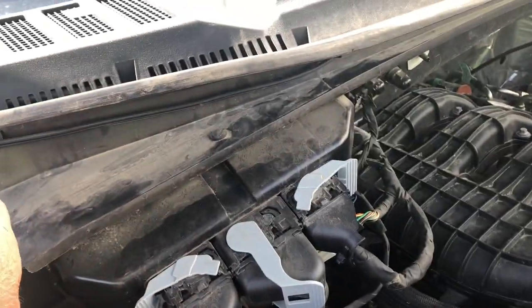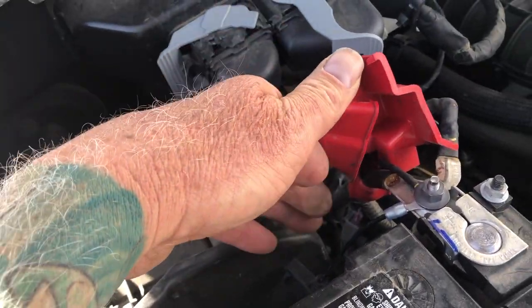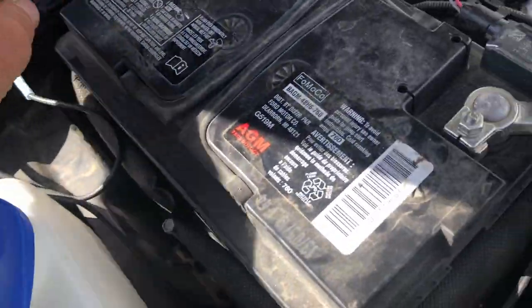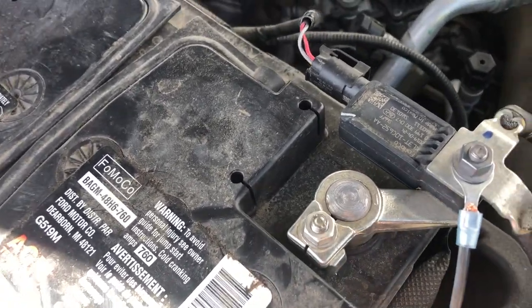Okay guys, that was actually pretty simple. I got that power line ran over here - the ribbed one is the positive and has an inline fuse. I crimped on a cable and over here all I had to do was crimp on a ring terminal and put it onto the ground lug. Okay guys, this has gotten kind of long-winded - I'm two videos ahead from here and it's still not done. But we'll end this one here. If you're interested in this towed vehicle brake stuff, you can watch the next couple of videos. Thanks for watching, hope you guys have lots of love in your life and be safe out there.